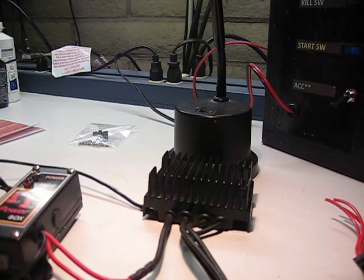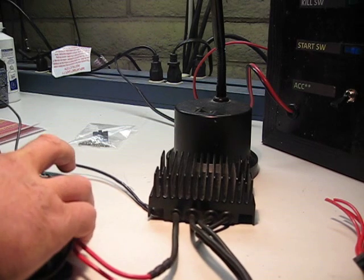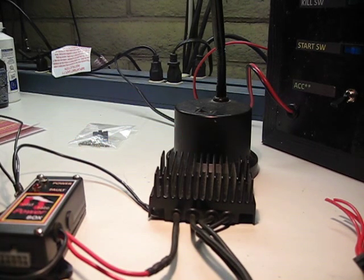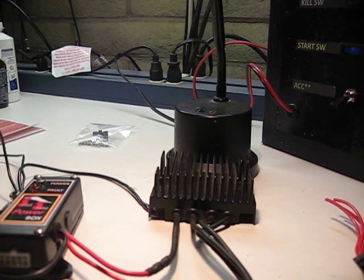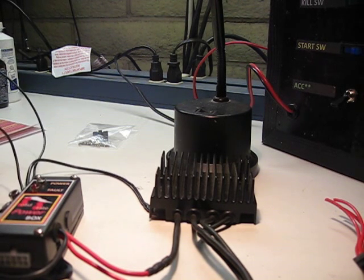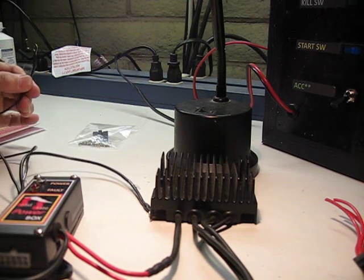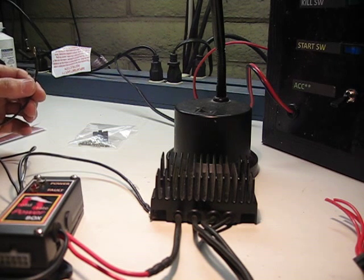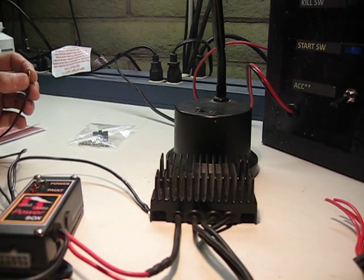So this is mounted on typically your electronic side plate, so that both the RR and the solid state power box are shock mounted in rubber. And then we have two other wires, and these are a little bit longer because one will go to your battery ground, so you'll put that one right to the negative terminal of your battery, and then the other one will go somewhere on the frame, so that you're picking up any frame grounds, either from a blinker, or if you have a Dyna S, then it's trying to run all the return power for your ignition